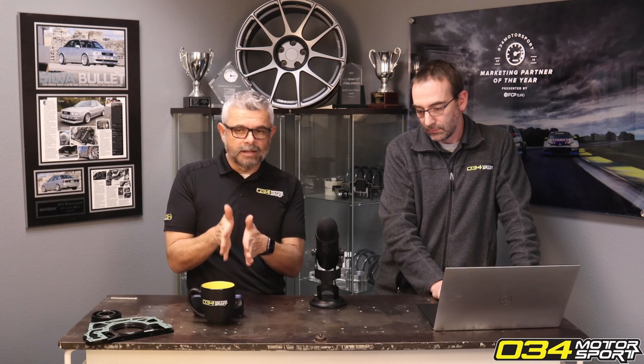They work for heat shielding, but they can have a very detrimental effect on the component inside, because the heat buildup can be tremendous. The right way to keep heat in your exhaust and out of the turbine housing is to do a coating on the inside of the header and the inside of the turbine housing. This keeps the heat inside where it's supposed to be, and keeps it out of the substrate that will get damaged by it.